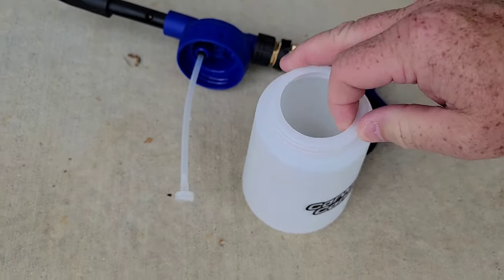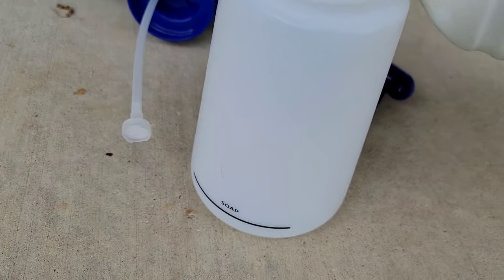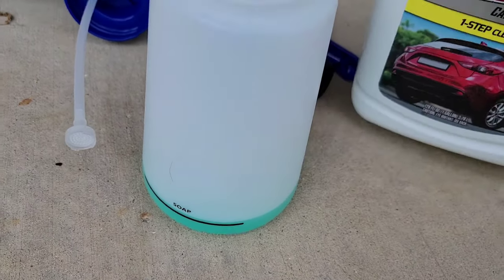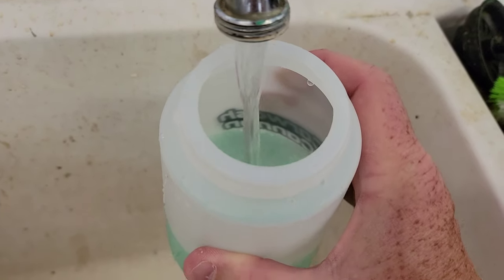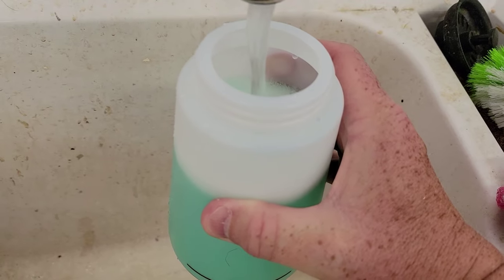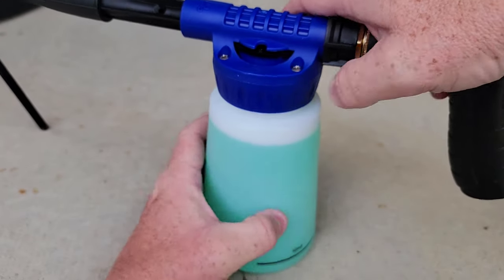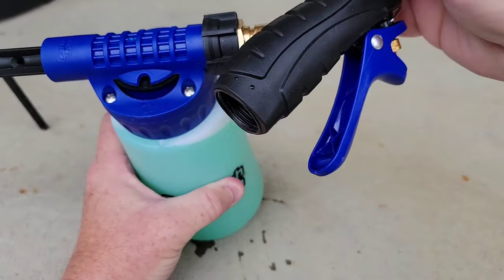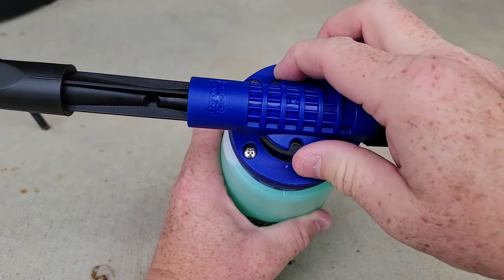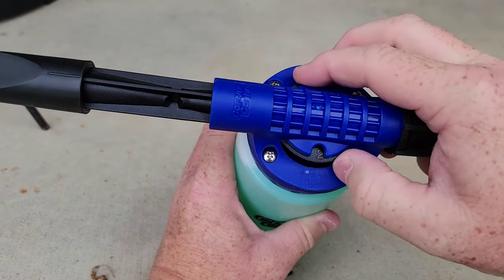So I've got my jar — I unscrewed it from there. Again, it's got that line, so I'm going to take this Turtle Wax and fill it up to the line, maybe go a little bit more. Then I'm going to finish the rest with water. You want to run the water in nice and slow so it doesn't suds up on you, otherwise you'll just lose a bunch of the soap to suds. So it's full of water now — we filled it up to the soap line. You simply just screw this on and get it nice and tight. Now I'm going to connect this to my hose and set this on three — we'll try all different settings. Zero is no soap; let's start off with three and see what it does.